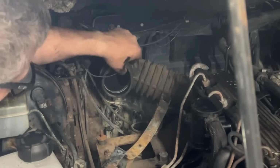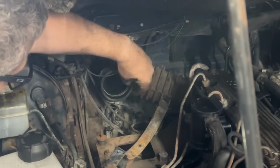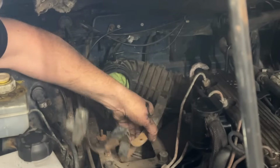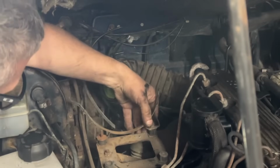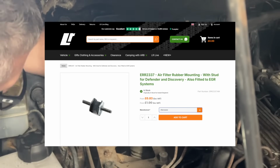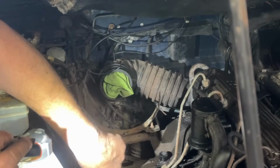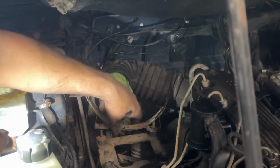We have got the airbox free. That's really mounted nicely and it's super clean, so that's a real result. So this is the problem we've got. We've only got one little cotton reel attached. This one is on its way out. So basically all I've done is I've just lubed the nuts underneath these cotton reels. So hopefully we can get those undone.